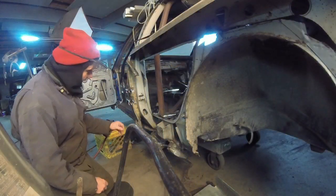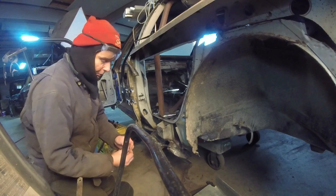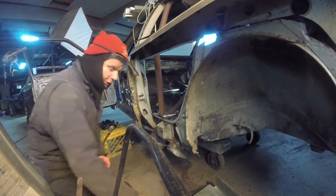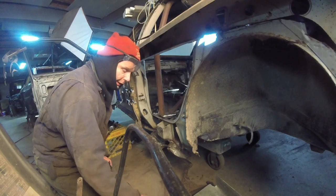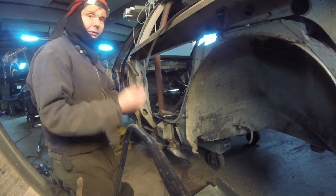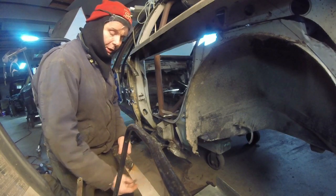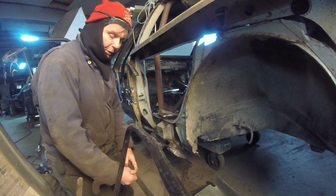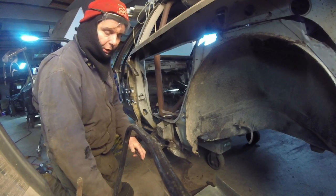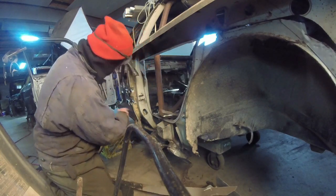Now, we have the tab that we cut and cleaned up on here. I also have pieces of metal. It's pretty much like 3 times the thickness of sheet metal. What I did is I looked at the fiberglass to see how thick it was, so you can see this. This is what the flange is going to be, and if you put this on top of that, that entire width, because you're also buttoning it up to the actual body, is pretty much just a shade over the width of the fiberglass is what I want. So I took a bunch of these, I put them inside here to space everything out.